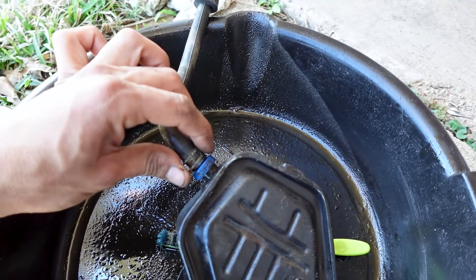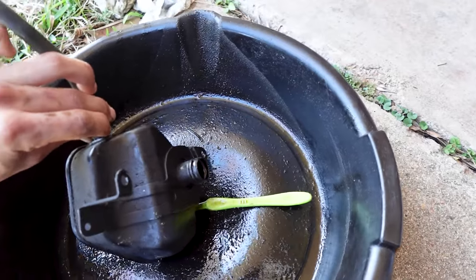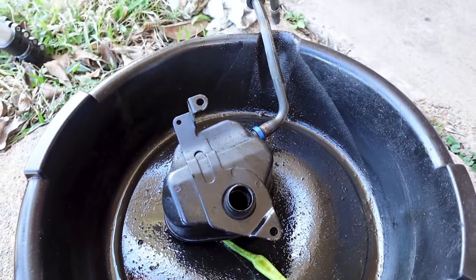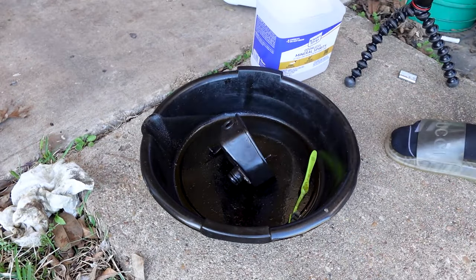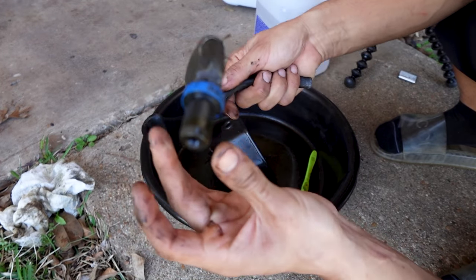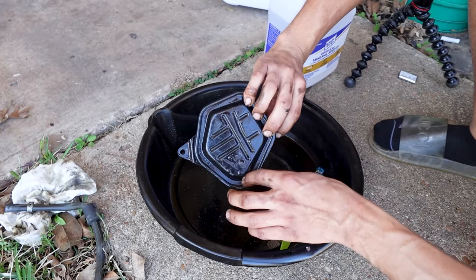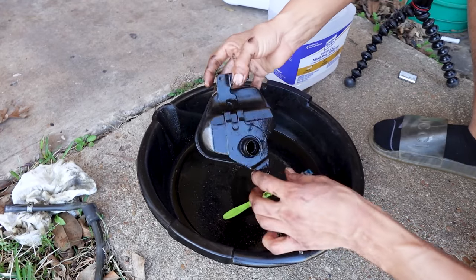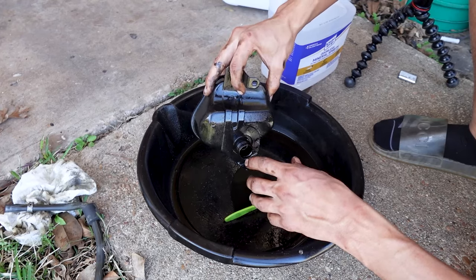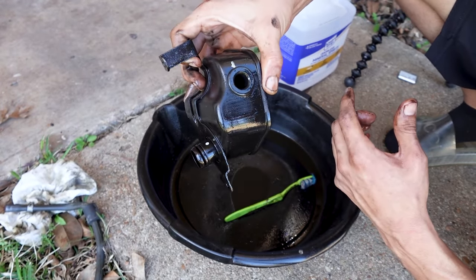Here's the PCV valve — the blue thing. I'm going to be taking that off. If you take it off inside the car it probably makes it a tad bit easier to bring the box out, but the box is built around that water hose so you've got to push it far back to get away from it. Here's that PCV hose — give it a little shake, don't hear anything, so definitely this is bad — that is trash. This car has almost 200,000 miles on it so I think it needs to be cleaned. I saw someone on YouTube clean the inside of the box using mineral spirits — shake it around until it starts to come out clean — so that's basically what I'm going to be doing.